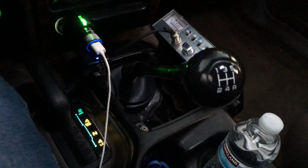And then one other piece of advice I'll leave you guys is that when you remove the actual automatic shifter from there, you guys will have two cables. One's going to be your shift cable, and then the other one is the lockout cable for your ignition key. So I actually removed the cable for this key, and it's really easy to do. If you lower the steering column, you don't even have to take the covers off. There are two Phillips screws just behind this, and if you just undo them, you can remove the whole thing and you don't need it at all. So what you get by doing that, you'll no longer have that issue of the key being a problem with the lockout cable if it's not positioned just right.